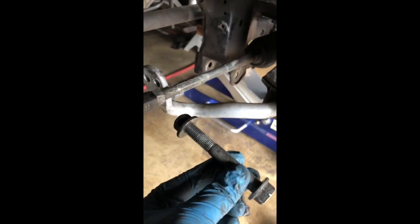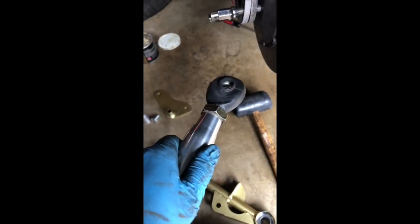Next part — this is where the front bushing was, and this is the bolt that was used. This bolt I'm actually going to move to the rear, take this nut off, and use it with the new hardware. This hardware is the right size to fit, but this one doesn't fit because it's too thick. So you're going to trim off some of this boot here, and this side is going to sit flush on the floor of the car, while this side is going to sit like this in the rear.